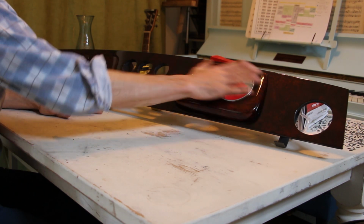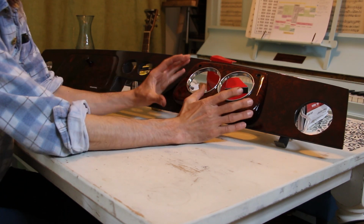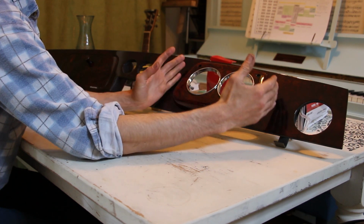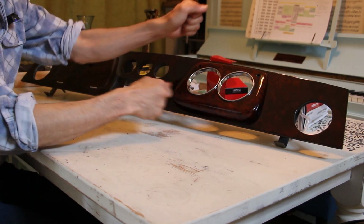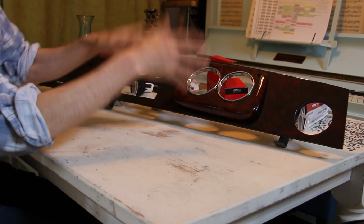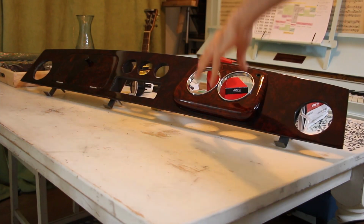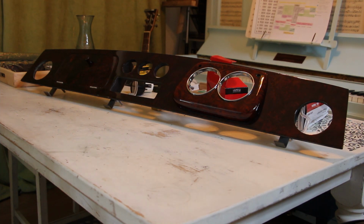But here's the plan. I've gone for a 2 clock one because of trying to fit the Ford clocks. I'm probably going to have to cut some material out. And we've got a plastic surround, and we'll fiberglass and gel it in and paint it all to make it look nice. So that's the plan with that, because obviously I've got 4 clocks, not standard Mini clocks.